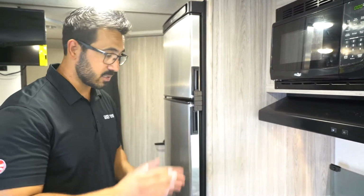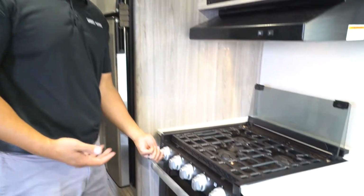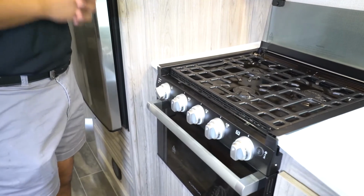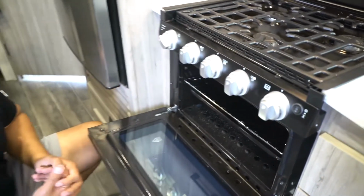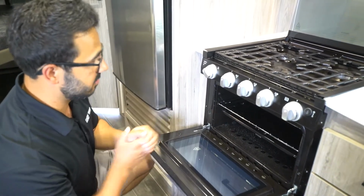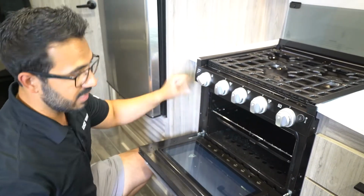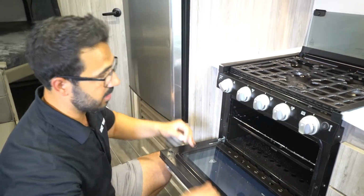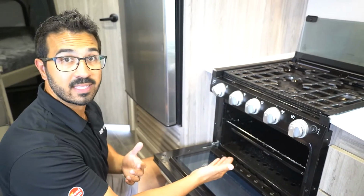Now, another safety concern is with the oven, and I've seen this, unfortunately, too. Because this one does have a spark ignition, what people do is they go to spark it and walk away and keep the oven door closed, and that is not what you want to do. You want to open the oven door up for a couple reasons. One, to let air in. In the event that there's a time discrepancy between when you start the gas flow and hit the igniter, you don't want a fireball. You want a place for the gas to be able to escape. So you want to keep the oven door open. Plus, again, for safety, you want to know that the thing is actually lit.